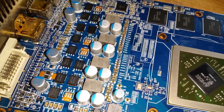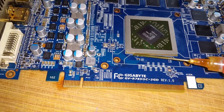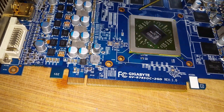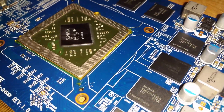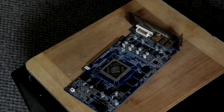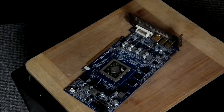I have a feeling the reflow will definitely help. Always use the flux, which I always put on from every single corner and every side of the chip. You can now see the flux is on every single side of the main GPU chip. Now we will reflow the card. We will set up 290 Celsius and simply heat for 10 minutes for the main chip.